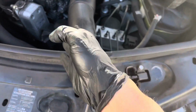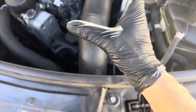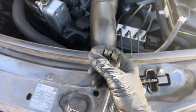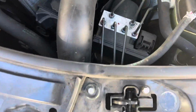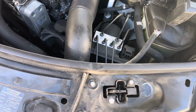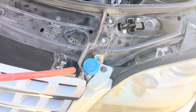So now I don't know, the compressor could possibly be physically damaged on the inside. I don't hear anything. I can't feel anything from the clutch because there is no clutch. This is one of those locked up permanent pulley systems that's a breakaway, so you can't feel a clutch or anything like that. Yes, I have the tool to connect up, but I'll allow the technician, if he wants to use it, to use it. He has a scanner. If he knows enough on the Mercedes, he could get in there and drive the actuator and tell it to go. He does have gauges himself, but there's nothing for me to do here.